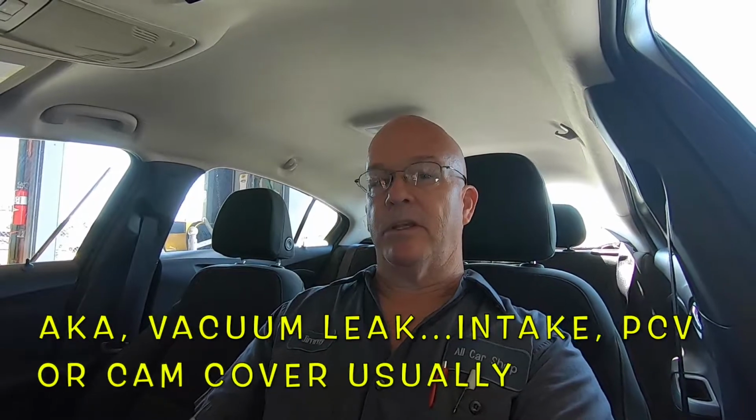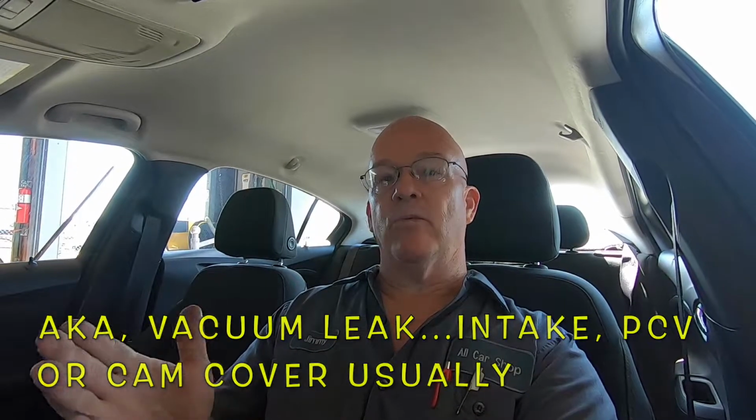These are pretty bad for intake manifolds and stuff, but normally the throttle angle will be reduced in the case of a bad intake manifold. It doesn't get increased. An increase in throttle angle, like I said, is a restriction. So it seems like it's all fixed. We're going to take it on one more road test after it cools down before we deliver it back to the customer.